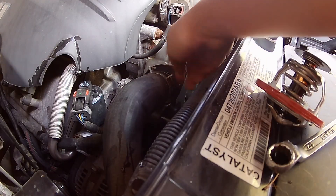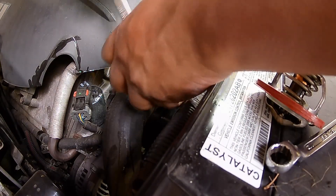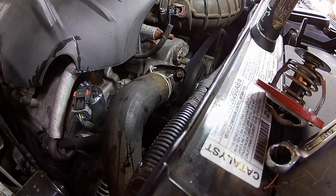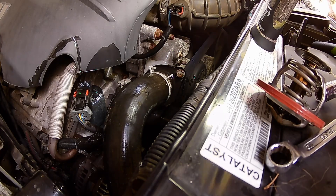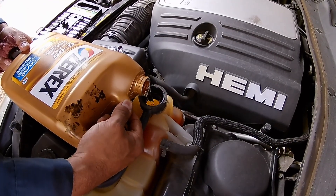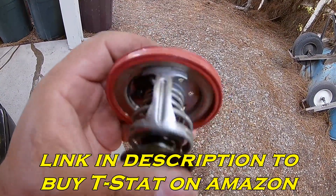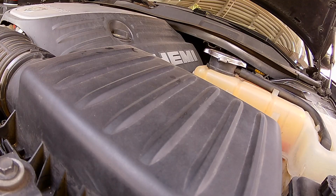If this little clamp is in your way, just grab it with a pair of pliers and move it in either direction to get it out of your way. Double check everything — good. We're going to go ahead and top off the coolant a little bit. Yeah, the thermostat was shot — that rubber piece is gone. Good thing we changed it out. It's probably the original. My partners John Travolta, Ray — my other partners.